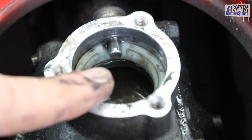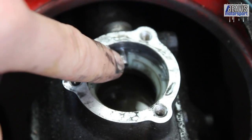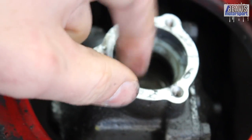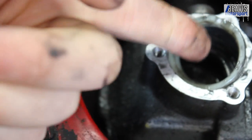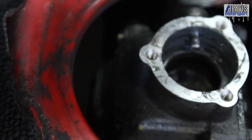On the later five-speeds for the NBs, there's a nugget here and also one on the other side. Thankfully this is an early NA without those two nuggets, which makes removing the white ring easy enough — you just lift it out. On the NBs you'll need to get a couple of screwdrivers and lever it out the side. With an NA you can pull it from the back, and it lifts away.